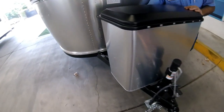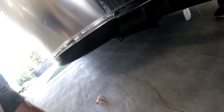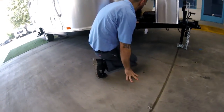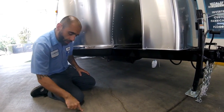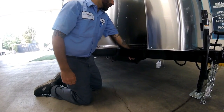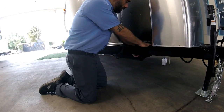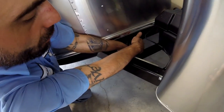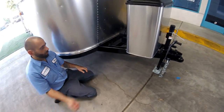On this side you have your spare tire cage. Your spare tire is on the bottom right there. It has a triangular hook — two hinges in the back and it swings open from the front. There's a handlebar here; you just hold it, lift it up a tiny bit, and remove the pin. The black part swings down, then you slide it out.